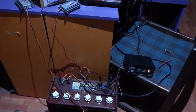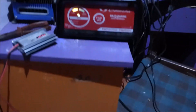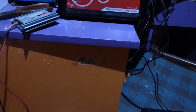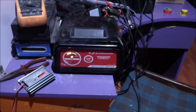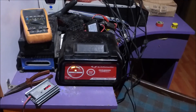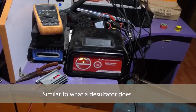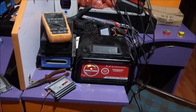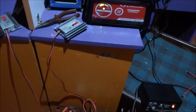I told you I'd come back in a few days, but something happened and I had to update you. Let's start with our charger — I have a Schumacher 10-amp charger and a 2-amp maintainer, and I never really paid attention to this until yesterday. What this charger does is push out 10 amps for 55 seconds, then 2 amps for about 2 minutes. So you see the battery voltage go up and then drop — 10 amps, then 2 amps, cycling repeatedly.